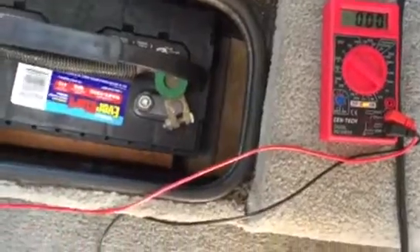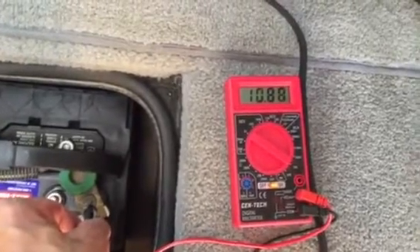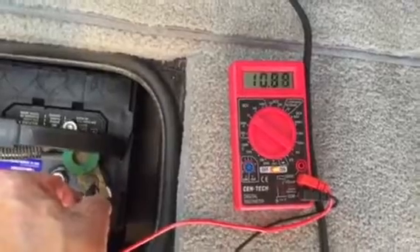Let me get the voltmeter. By the way, if I put the voltmeter on this thing it shows 4 volts unless the generator's running, then it shows 14-something. Here's the positive — I'm gonna measure it. I was saying I got 10 volts, so I had 13 earlier and I haven't run anything. Something may be draining the battery. Let me go ahead and start the engine so I can start the generator.